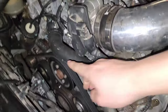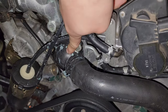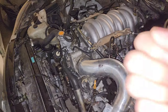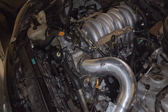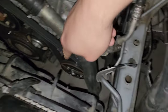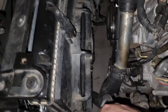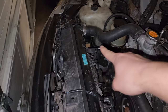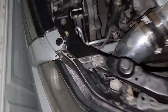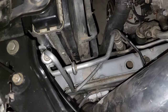It has a few hoses - check this hose out right here. If you need to replace it, do so because it gets old over time and will honestly crumble into pieces. On my other motor that thing broke into little pieces and those pieces fell into the holes and went all the way down into the other side of the radiator. That goes connected right there, same thing over there. Then you have the condenser lines that connect right here - you need those special tools I showed you earlier to remove and reinstall them.